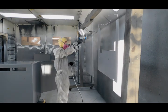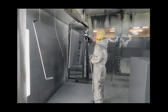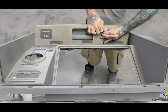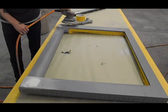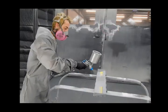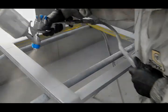The tech sprays two coats for maximum coverage. While the body components are drying, they work on the customer fascia and collar assembly, performing body work if there are any imperfections and removing all old decals. Once the body filler is dry, they are sanded and primered. After the primer is dry, the collar and fascia are pulled into the booth and sprayed with a base coat. Lastly, they're given a clear coat with a light metallic flake to closely match the manufacturer's original color.